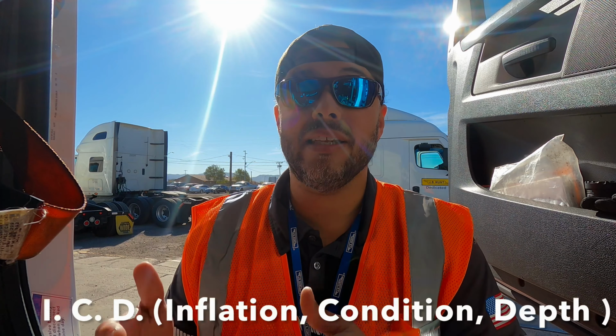So you're walking up to the vehicle and you're looking for anything that might stand out to you. I'm gonna start with lights, leaning, and leaks. We'll take a look at the reflectors. Make sure they're clean, not missing or broken. And are they in the right color? Red in the rear, amber everywhere else. Easy way to remember that is R and R. Red for rear. Check that all lights, left, right, four ways, headlights, high beams, clearance lights, are clean, not missing or broken, and again, in the right color. And check for leaks, any fluids dripping on the ground or puddles underneath the engine and transmission area. Then you want to check the vehicle for leaning toward one side or another, possibly indicating poor suspension.